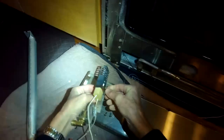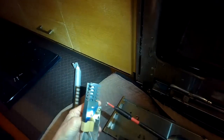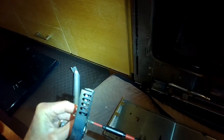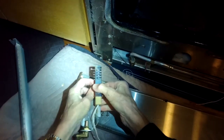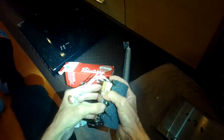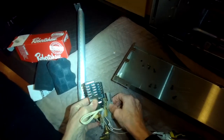The igniters are not that expensive. This is a Robert Shaw igniter we're putting on, which is a replacement for the Capital one. You can get it from Capital too, but the Robert Shaw one is a lot less expensive — we'll put a link in the description below. These are really good ranges, a lot like Wolf, Viking, and Blue Star ranges. The Robert Shaw igniter comes with the igniter and wires, but not the terminals. We take those off the old igniter and splice them onto the new one, which is easy — it comes with ceramic wire nuts.